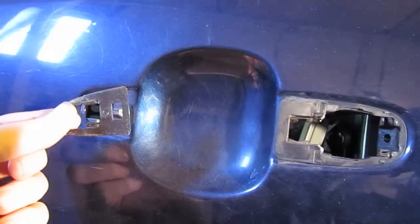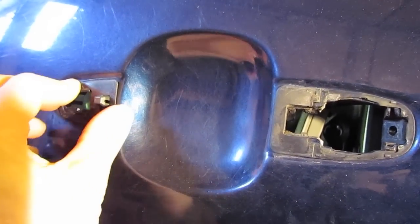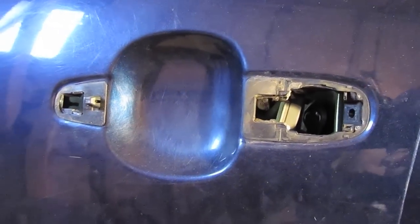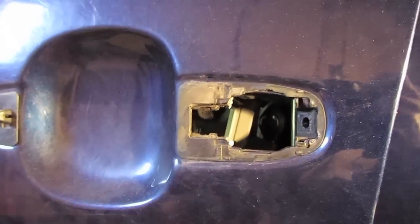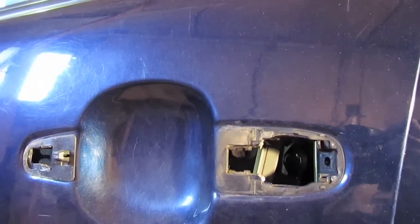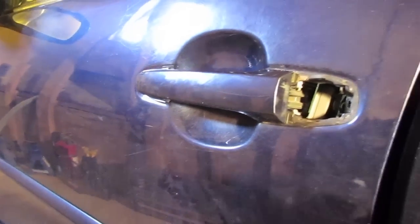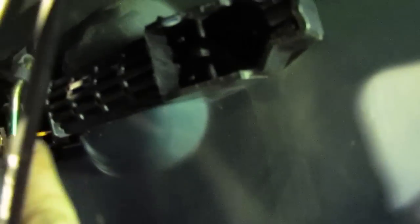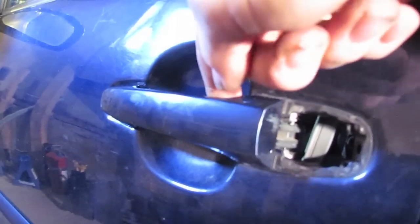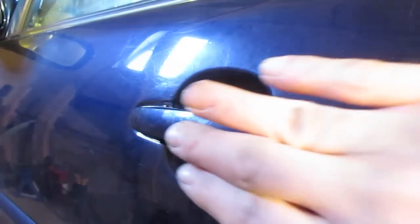You also want to make sure you have the plastic covers installed into the holes, which prevents the door handle from scratching the paint and causing premature rusting. With that installed, move on to the door handle itself — you have to manipulate it and it will actually slide in and forward into position. It took two hands so I couldn't show the whole process, but on the inside of the door mechanism you actually have to pull part of the metal rod down, which releases part of the tab. That tab is what the handle pulls out on, so you have to move it part way down to allow the handle to slide into position.